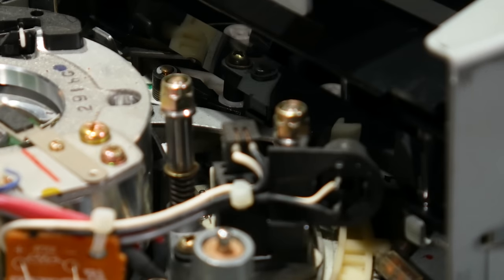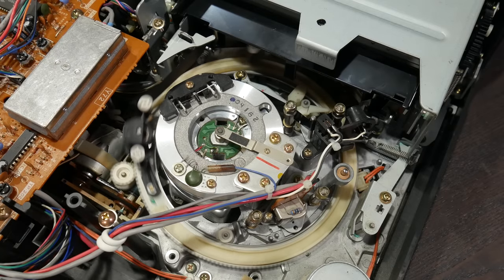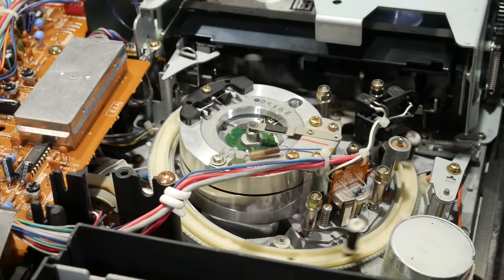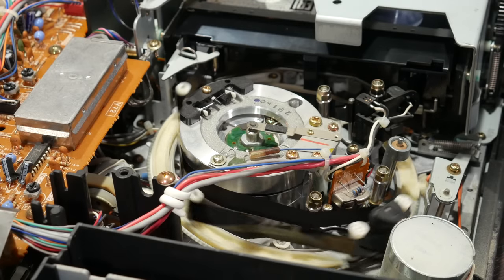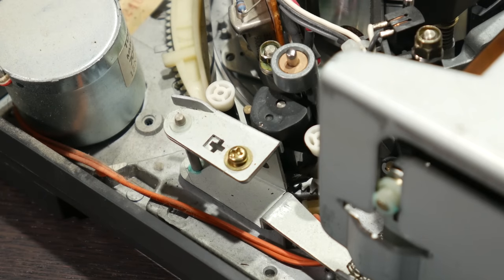When it's time to get the tape out of the cassette, it, along with the tape guides flanking it on either side, yanks out about a mile of tape and makes a very, and literal, roundabout trip to the capstan. Once it's there, a little lever dude will put pressure on the pinch roller, pushing it against the capstan, and now the tape can be moved through the mechanism. This loading mechanism is essentially just a miniaturized version of the U-load system Sony devised for their earlier U-matic.